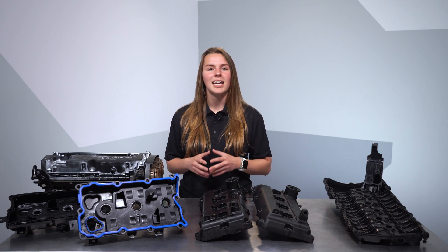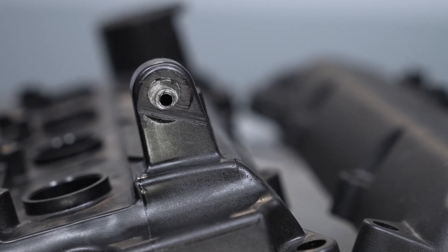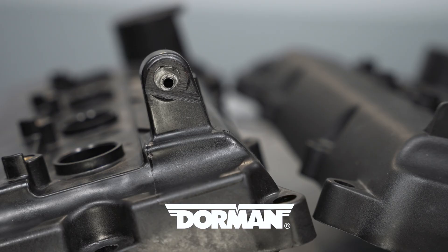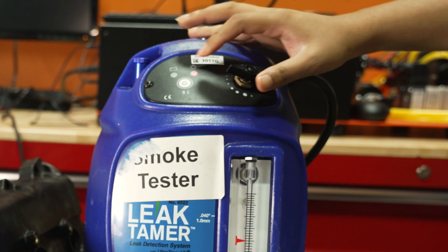Consider the high combustion pressures and increased blow-by from today's modern forced induction vehicles — the valve cover plays a more crucial role than ever before. If the baffling and separators inside the valve cover are not engineered to work as the OEM intended, the result is more oil in the intake track and in the combustion chamber. Many modern engines are also direct injection, so fuel won't wash the backs of the valves. Look at this valve cover — it fits a few popular Nissan four-cylinder vehicles. Note there is a tower here to route combustion gas minus oil back to the intake manifold. If designed properly, this tower on both the OEM and Dorman covers will have a small orifice. We've cut these apart so you can see the difference. The orifice forces the oily mist to hit the tower, condense, and the oil drains back into the cover. With the competition's setup, all that oil carries over into the tube feeding the manifold — take a look and you can see what that looks like in practice.